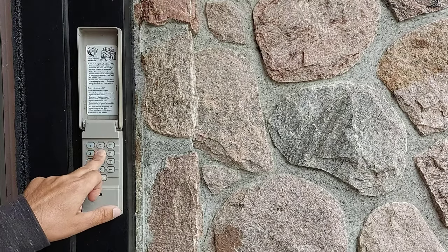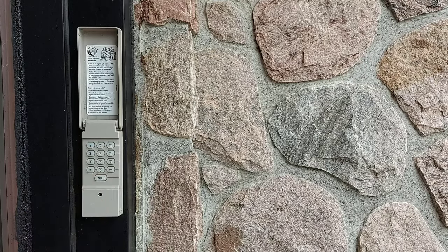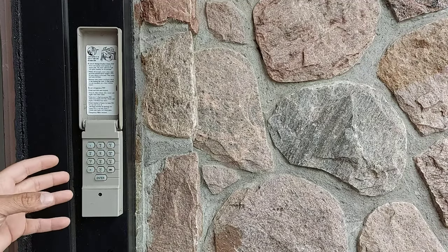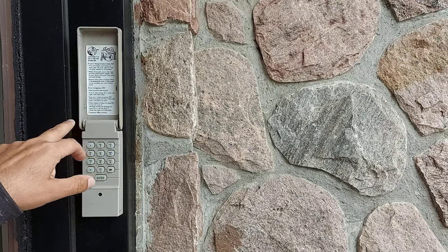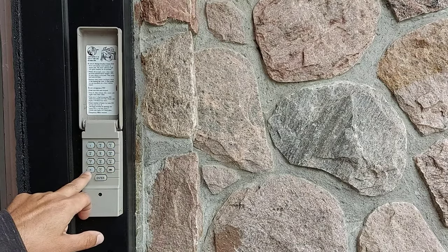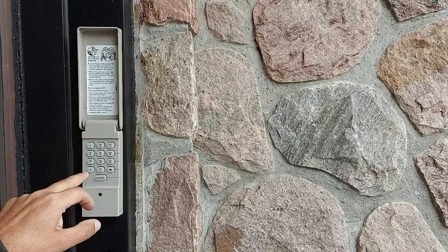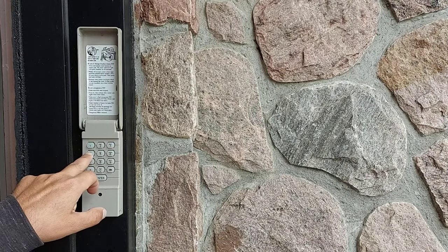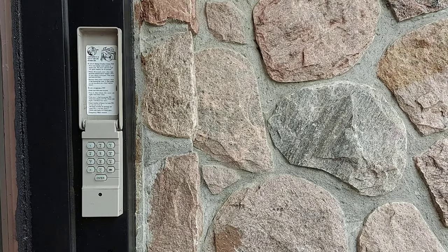Let's go with two, five, two, five, and we're going to click enter. Your motor lights will now blink four times. Now you can enter the number of hours for your temporary pin — type in something like three hours and then press the star button, and your lights will blink once. Or if you want to set the number of openings, let's say four openings, you click four and then hit the pound button. Now your temporary pin is learned.